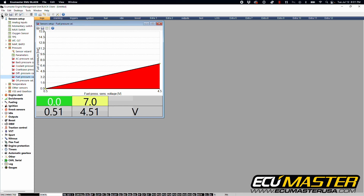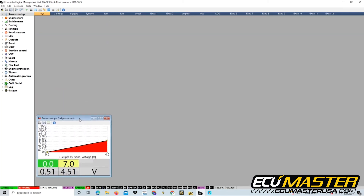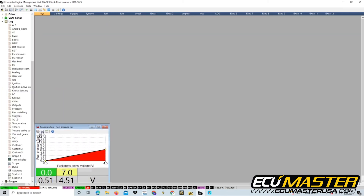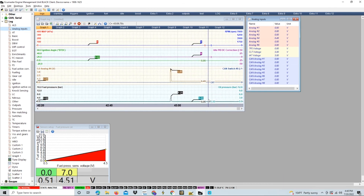Now that this is correct we're going to make it permanent to your EMU Black. Since we finished setting this up we're going to go and verify that the sensor is working. Make sure that you're connected to your EMU Black device — the connection status is connected and highlighted in green. We'll open up our graph log and analog inputs to show the voltage as we plug this in. You'll see that the voltage at analog 4 increased as reflected in the graph log, and the fuel pressure increased as well because that's what we have this channel assigned to. Now that we've verified the sensor is working, refer to your EMU first start checklist to continue setting up this device for your project. Thanks for watching.